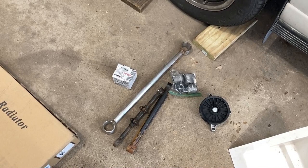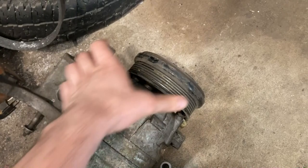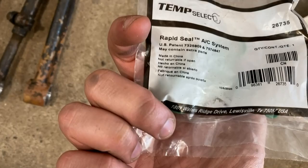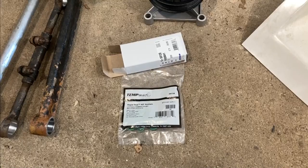Next is an AC pulley delete. The air compressor has quite a bit of resistance when turning, and removing any rotating mass from your system is probably the most effective way to pick up power. They sell little pulley delete kits online. If I were to not do that, I do have the equipment to install AC — all the O-rings you'd need, the green hydrogenated nitrile seals, and the conversion orifice tube for going from the old Freon to R134A. Other than that and recharging the AC system, you just need a hose, which I cover in a previous video. Don't forget to buy a new AC dryer while you're at it.